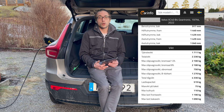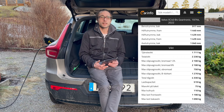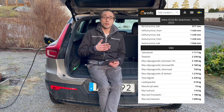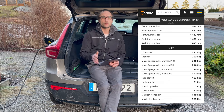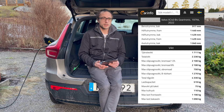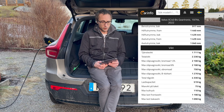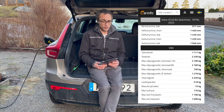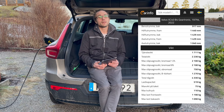With a BE license you can tow a caravan - that's simply it. In the standard range between 1500 kg and 1800 kg, that's what a typical caravan weighs. The old XC40's total weight is 2230 kg with the petrol engine, and the service weight (tjänstevikt - car weight plus driver) is 1711 kg.